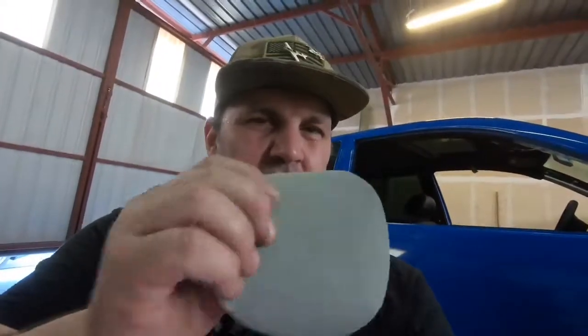So I've been color sanding and buffing, taking my time at it. It's a lot of work to do it right, and in the heat it makes it an even harder job. But what I've been using is the 3M system, and you've got these discs called the Trizac discs. They feel like cloth material, but you hit it with 1500 and then you'll hit it with 3000, which feels like a sponge almost. The discs aren't cheap, but it'll take like 5, maybe 6 if you're new at it, probably 6 discs of each to do the car.